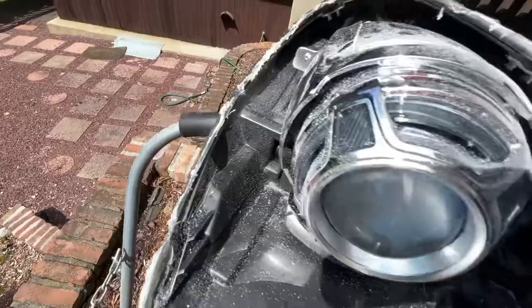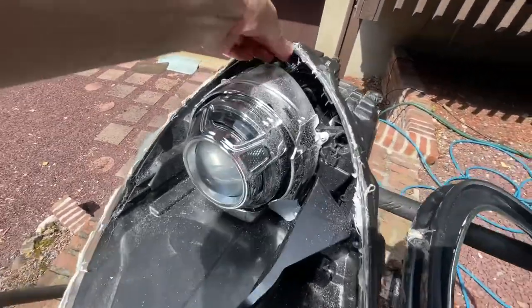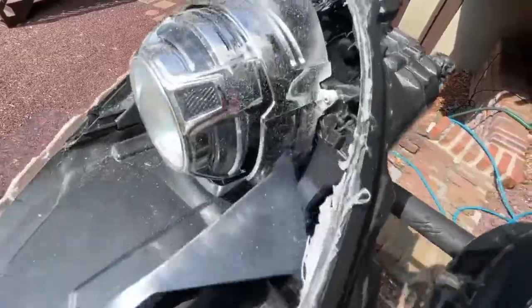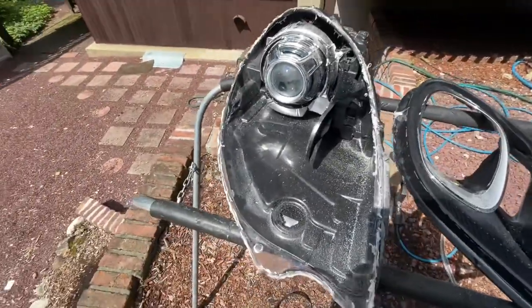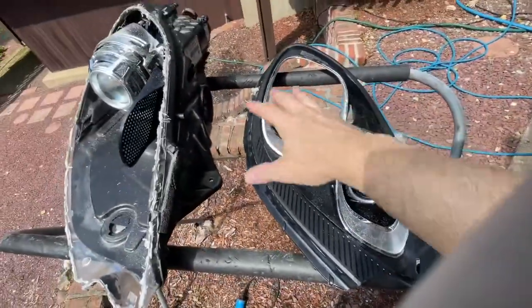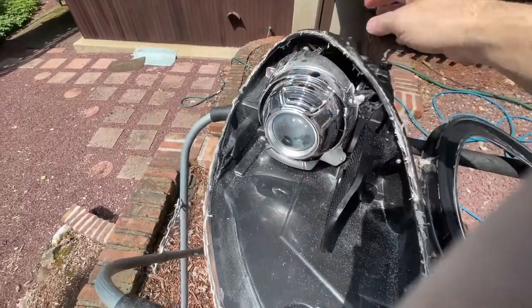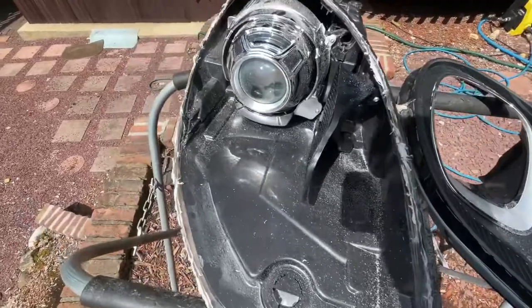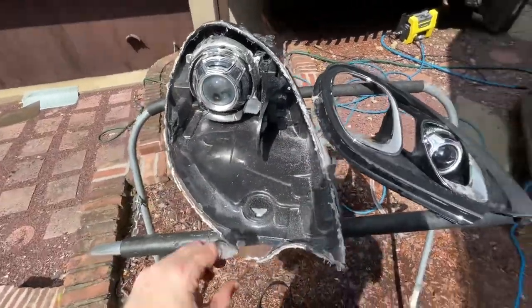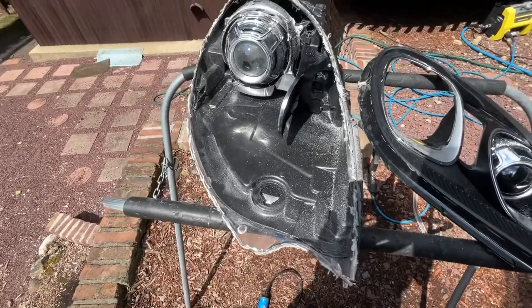You can see down in the little area where it was mounted there's a lot of carnage in there, so we've got to clean all that out. I just want folks to appreciate that this isn't easy — it creates a huge mess — and I still have all of the old seal to get out. I'm actually going to disassemble all of these components because I'm going to paint them black, and I don't like working on the housing with the projector and all the electronics in place. So I'm going to disassemble the entire housing, get it all cleaned up, and then this housing is going to go in the oven — that's going to allow us to heat up the butyl enough to remove the rest of the seal.